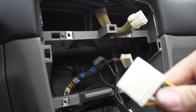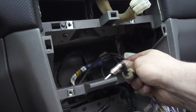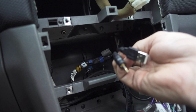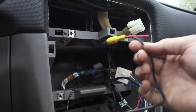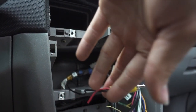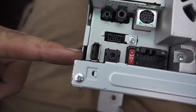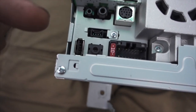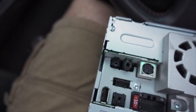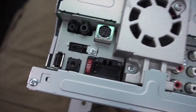Take your one end, then you have your antenna wire. This is my extension to my iPhone cord as well as my 3.5mm headphone jack that's located down below, as well as my cord for my backup camera. All this stuff has to get connected to the back — that is where that big connector we just wired up goes. The USB is where you can either plug an extension cord, which does come with it, or an iPhone cord directly. I have my extension already ran so that goes in there.